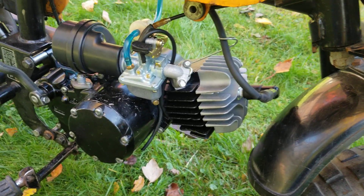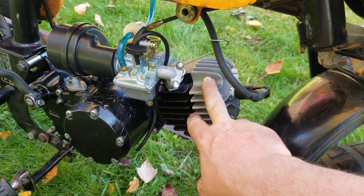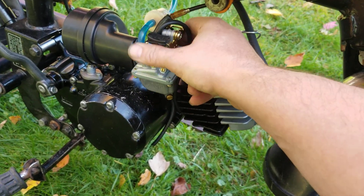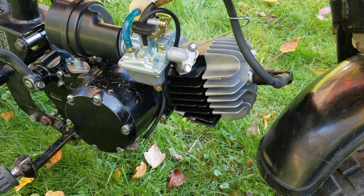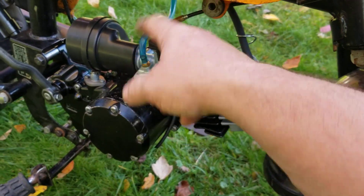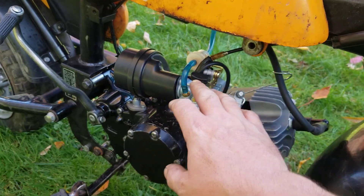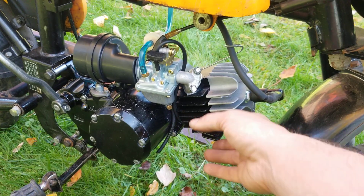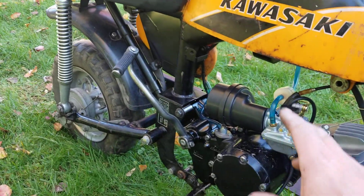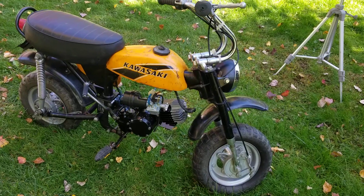We got the scooter lead on here with the factory cap screwed in with the grommets. A couple things we've done to this motor: it came with the CDI ignition but we put a brand new carburetor on it — looks like it might be crooked so we'll loosen that clamp and straighten it. We're going to try to fire this thing. I put gas in it, ran the line in a previous video, and got the oil bled out, but I haven't started this engine yet. There's no exhaust — the exhaust is going to be on this side, the factory pipe will come up, loop in.